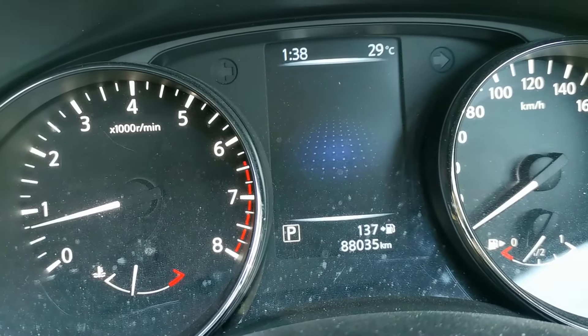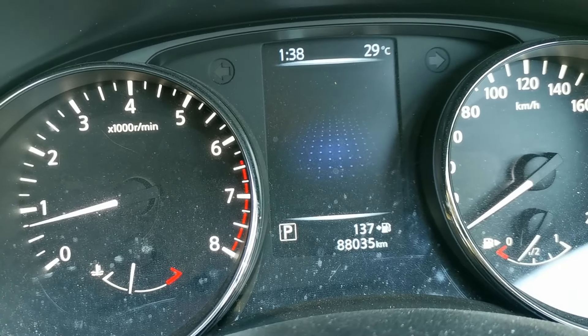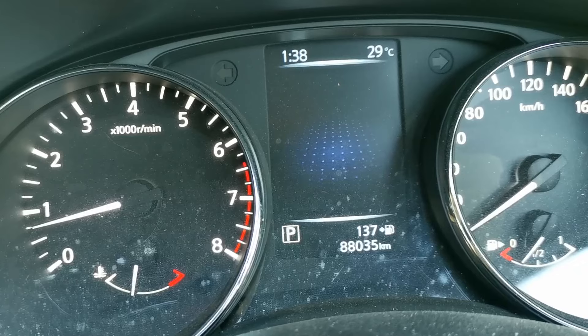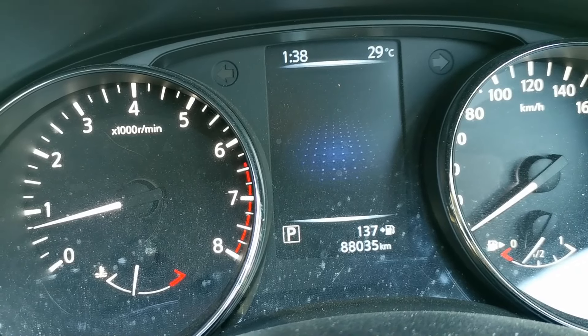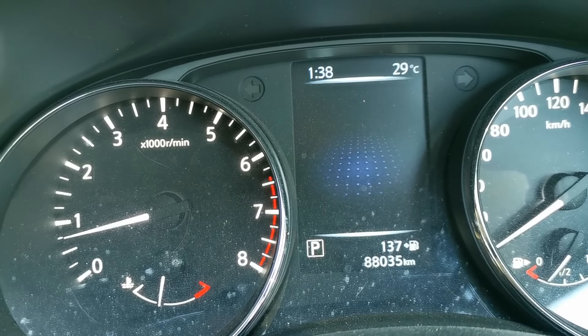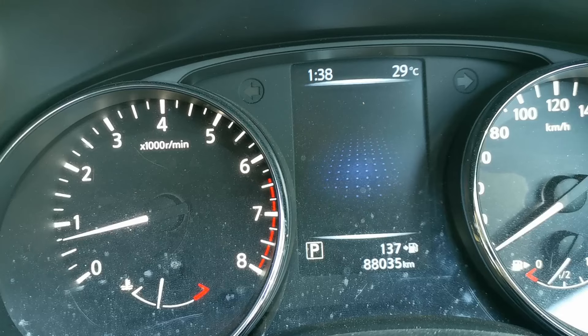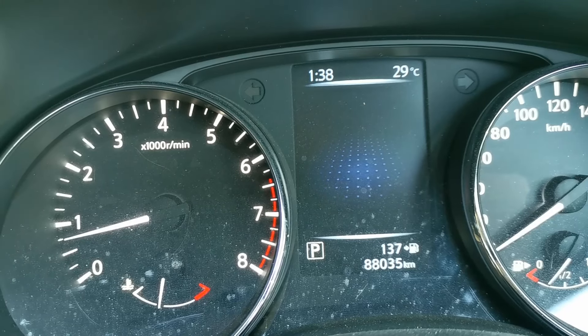The battery light has remained off and no faults are found. As I was seeing with the LIN bus communication when monitoring in the workshop for a long period of time, it has a continuous signal along that line with no dropouts at all — since I rerouted the wiring loom and re-secured everything.